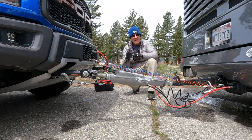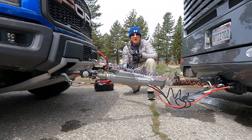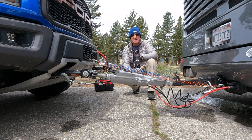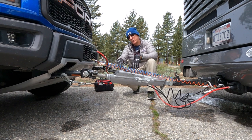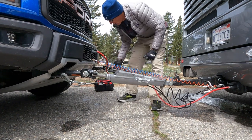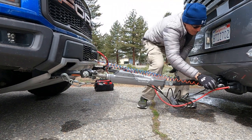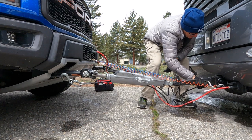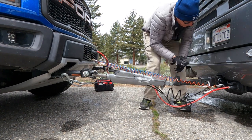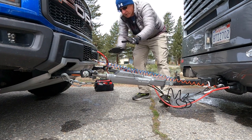We're all connected. My last step before leaving is a safety check — I touch 12 points of connection along with jiggling others to make sure everything is sound and I haven't forgotten anything. I walk through and count all 12: 1, 2, 3, 4, 5, 6, 7, 8, 9, 10, 11, 12. Looks great. Give it a quick jiggle, make sure the hitch receiver pins are locked in — both of them, since there's an adapter — and everything looks good.